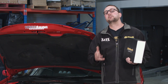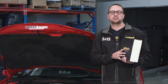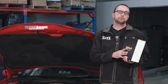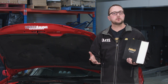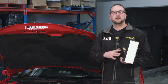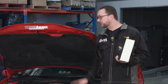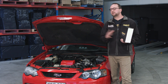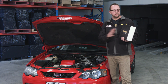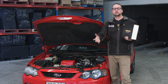Lastly, engine protection. All of the Elite Series ECUs have some form of engine protection so that we can shut the engine down or limit it — maybe limit the throttle based on our air-fuel ratios, our oil pressure, our fuel pressure, our coolant temperature — a huge range of conditions so that you can take care of your costly engine. The last thing you'd want is for something to overheat, lose pressure, or lean out. When the ECU knows that's happening, it can limit the engine so that you can limit the destruction.